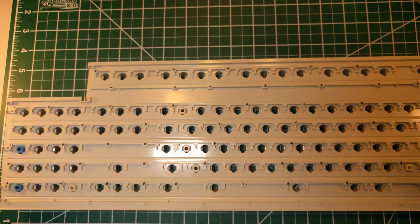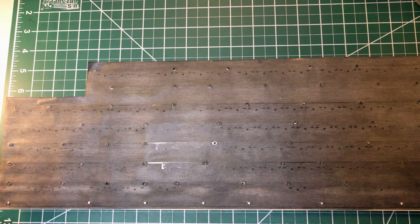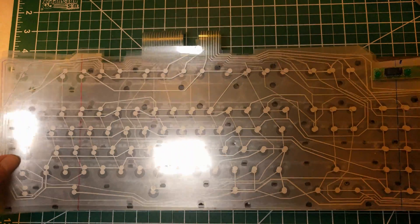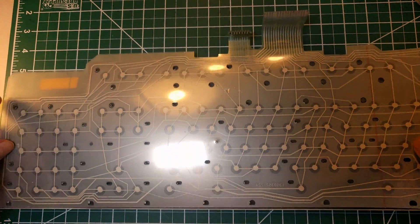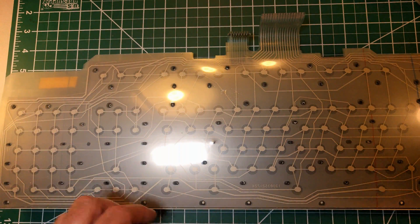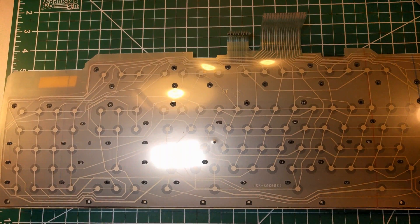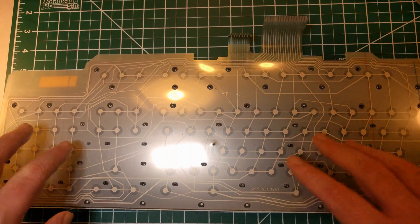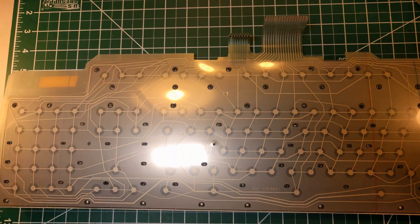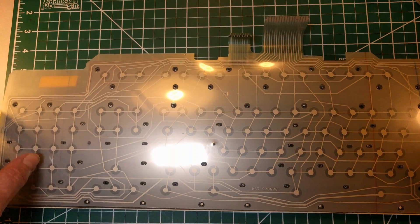I wanted to describe how to better know which holes to mark, improving on my last video. After you get the keys out, you can put this rubber mat back on - this is important. You need to do both of these things: both the rubber mat and the membrane. With that, you can tell which of these posts need to come off. I've marked them already with black magic marker, but you can just put a little dot on each one that has corresponding holes through both the mat and through the membrane. So you don't drill a hole that can't go through. There are posts on the barrel plate that have no corresponding holes on the rubber mat and sometimes not on the membrane either, so just do only the ones that will for sure go through.